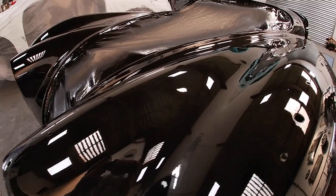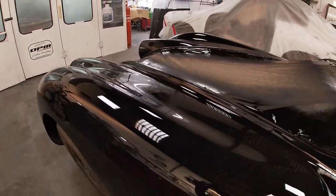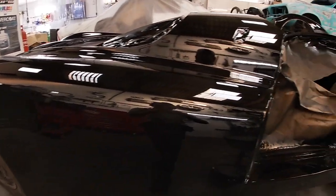So flattening and polishing — there's a lot of different techniques you can use, different processes you can do depending on the type of finish that you want to achieve. We're going to do a few videos on accent repairs with just denibbing and polishing and some of the less in-depth processes. For this Jag that we painted, the aim is to remove all the orange peel from the job — get rid of all those little ripples in the paint as much as possible.